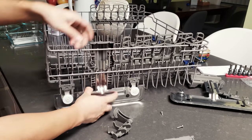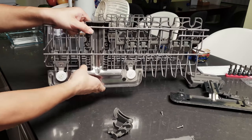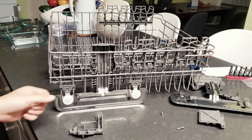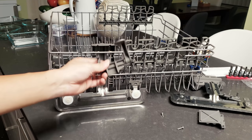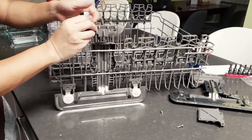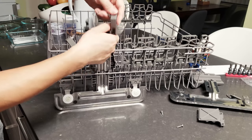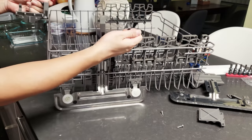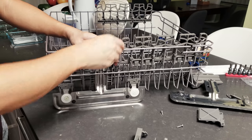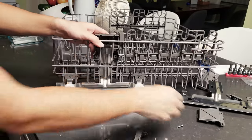Once it clicks into place, you can already slide the rail up and down — we're almost done with one side. Next, install the actuator. There's a hole for it, so pry the assembly slightly and drop the actuator into the big groove. Make sure you're using the correct actuator — this side must face inside and towards the front of the dishwasher.